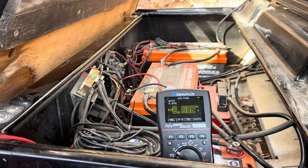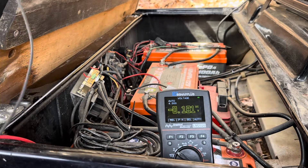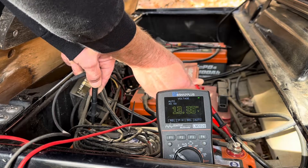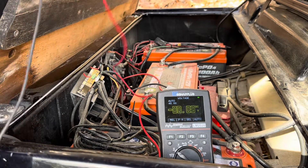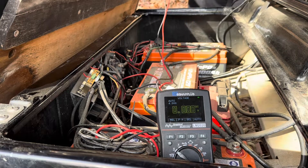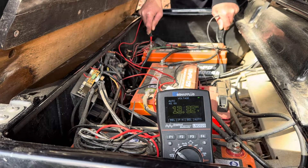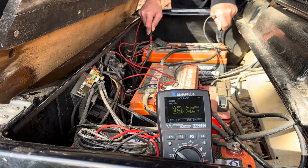I'm going to check the balance between each of the 12.8-volt, 100-amp-hour batteries in series to see how close the voltages are after not charging for two weeks. We'll start with the closest battery right here — this battery is at 13.33 volts. This one: 13.33 as well. Let me go to the far battery over there — this is the one that's got the lights on it at a 12-volt load, less than one amp since they're LED. I can't quite see the meter — y'all tell me what you see on the meter in the comments section.